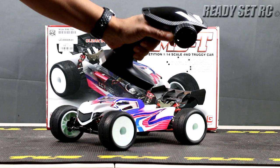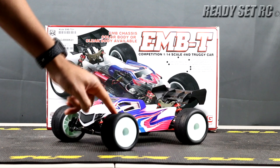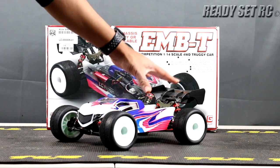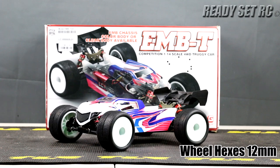The only thing I'm not too impressed with on this controller is the steering. Moving to the outside: we have foam-filled tires with an offset. The tires feel super soft and plush — really good. We want to see how this handles with the brushless power. Fairly thin body but it is a Truggy, so I don't think we'll run into issues unless we flip onto the lid. All the screws throughout are hex screws. The length is 345mm (13.6 inches), width 235mm (9.3 inches), height 129mm (5.1 inches), wheelbase 225mm (8.9 inches), and total weight is 1.1 kg or 2.4 pounds with the battery. The hexes are 12 millimeter.